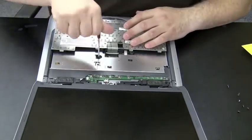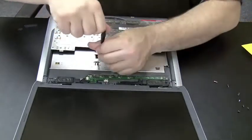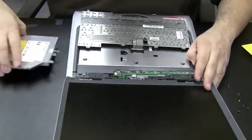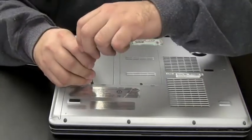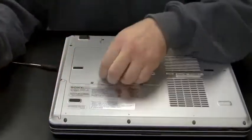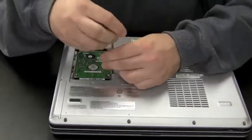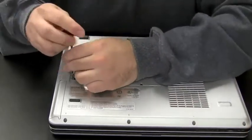In more recent years they changed the design of most laptops to make it easier to access the CD drive, but this is how you did it when this computer was made — probably around 2002 or 2003. Now you just flip up the keyboard, you can leave it attached, and it exposes the two holes where you have to put a screwdriver in to get those screws out. Then the CD drive will come out after that. There's one screw, there's the second one. Push the drive from the inside, it pops out, and there you go.